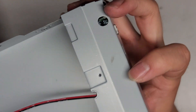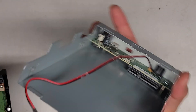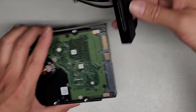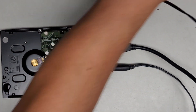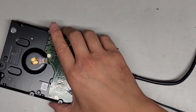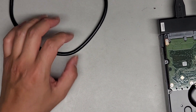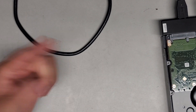There are two screws in here if you did want to take the whole adapter out — there's one screw there and one screw in that hole — but you don't have to remove the adapter to work on it. Here we have the hard drive; it's a standard three-and-a-half-inch SATA hard drive. Hopefully we're lucky. I'm going to plug this into my laptop using this adapter, powering it externally, and if we're lucky the hard drive will work. If it doesn't, we'll have to send it to one of those expensive data recovery places.